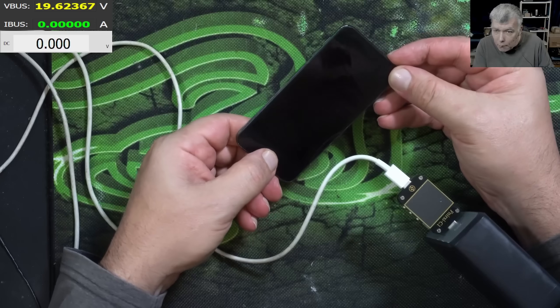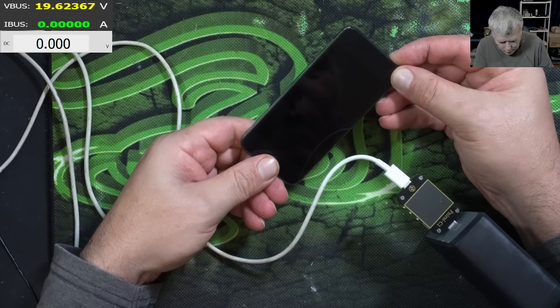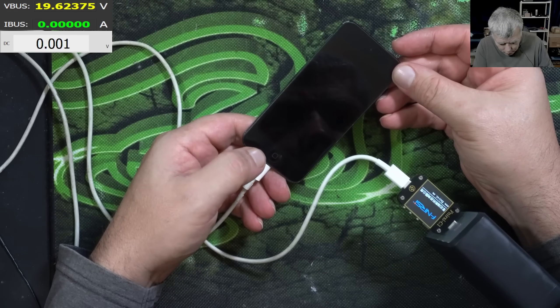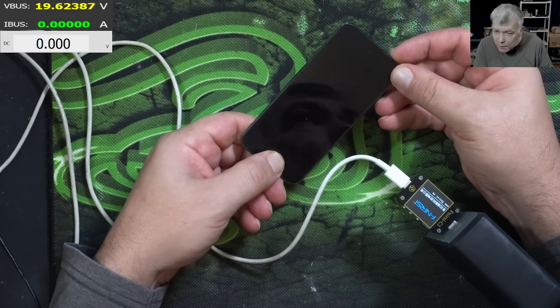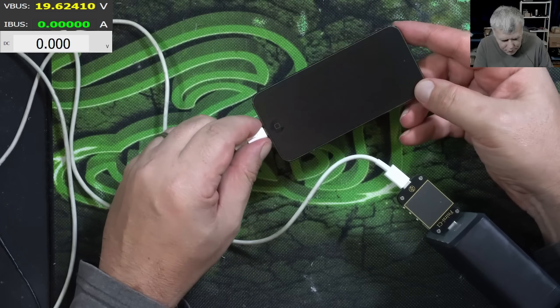Power and the home button — oh wait, it's working! Let's try one more time: power and home button, and it's staying on. The meter is staying on. 5.1 volts and 100 milliamps, and then it's switching off. Pressing the power button — nothing happened. It's just dead.